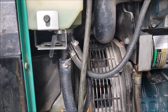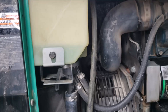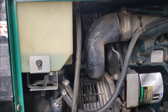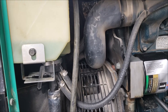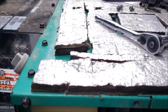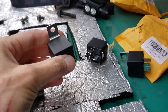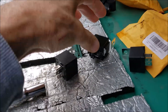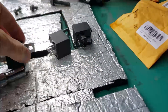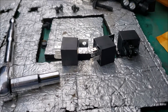ONAN recommended us to change out the wiring harness, but they say it's a major job because wires run all over the place. While we were in here, we noticed there are three relays — one is called a start-run relay. Seeing they're relatively easy to get to and this is already eight years old, we're going to try changing these relays because they're not that expensive, and relays can act intermittently. So that's our project today, and if you have an intermittent no-start situation, this may be your problem also.